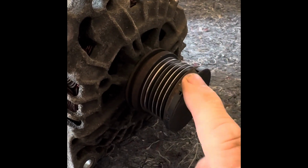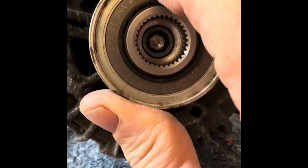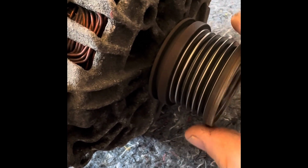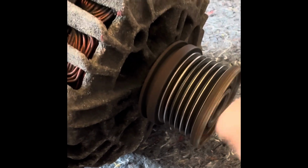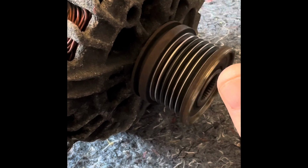But to check, you can take this little plastic cover off here. I just need a screwdriver for that. I'll take that plastic cover off and we'll just check inside. Cover's off, look. It looks all nice and clean in there. Sometimes if these go, it can be full of rust and crap in there, but that's all totally solid. There's a bit of a noise from the bearings, but nothing catastrophic, so it's not a bearing failure. I will replace the bearings anyway, because then I've got myself a spare one should the next VW we get have a problem.